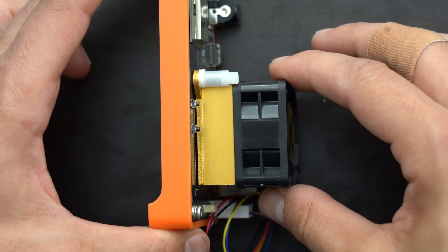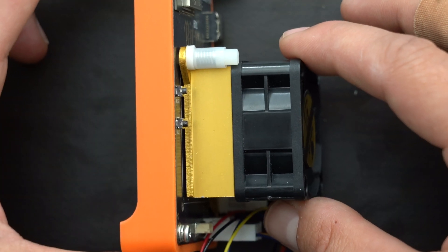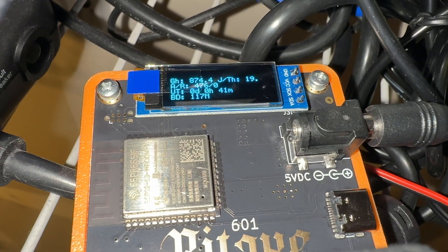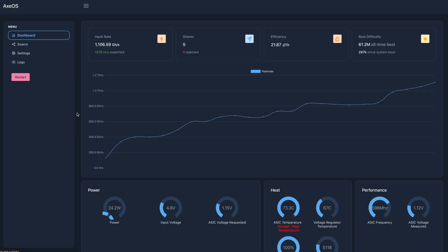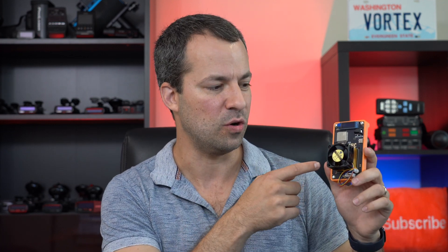Once that's done, I went ahead and got everything plugged in and powered on. The good news is it looks like the thermal paste is working well, and I'm still able to run everything without the system immediately overheating. The bad news is that still only applies when I'm kind of underclocking the unit. Unfortunately, I still can't run these specific Gammas at the default stock settings. That's a bummer, but at least now I can rule that out as a possible issue of why these ones have been overheating.